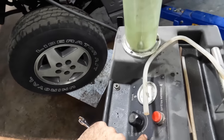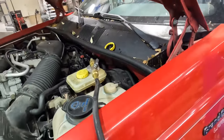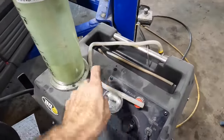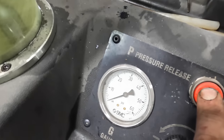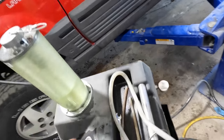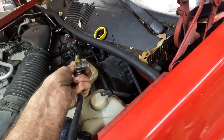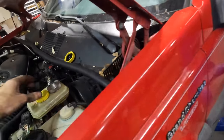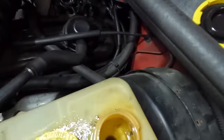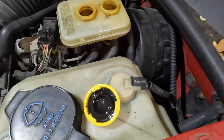This next step is critical: before disconnecting this line, we need to purge the air pressure. If we don't purge it, when we disconnect the line it's going to spew like a volcano and dump fluid everywhere. Venting now — okay. Disconnecting slowly. Recovering the adapter. And look at that — the fluid quality in the reservoir is squeaky clean. Beautiful. But we're a little overfilled, so we need to vacuum some of that out.